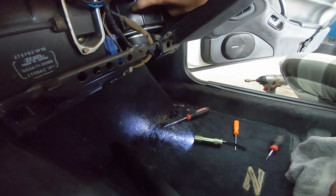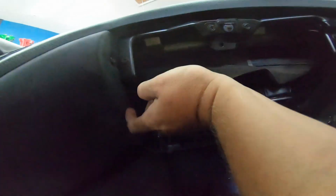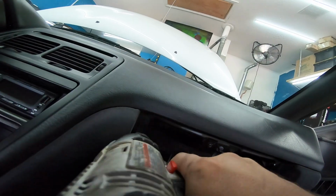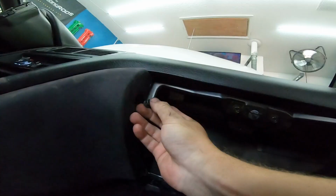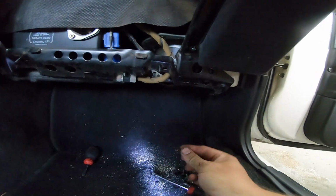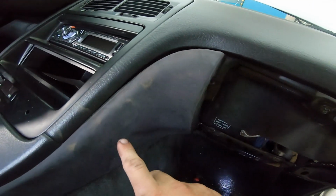Boom. Here's our blower motor right here. Here's our evaporator unit. We need to take this frame off to give us access, so hopefully we can slide that off, disconnect everything and slide it out. All right, boys, so we have to remove bolt here, bolt here, bolt here, bolt here, these bolts right here, one, two, a screw from right here, and then there's another one of these that's behind this piece of trim, and you need to very, very carefully unpop it, and then you see that screw right there. Definitely don't want to break this, would never be worth it.